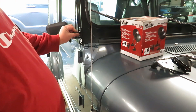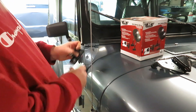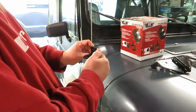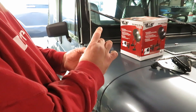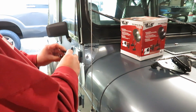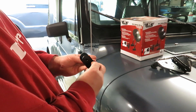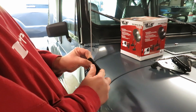I want to get two bolts in. So the only option I have is I'm going to have to score this an eighth inch off and cut it down here so I can get that lip through there. These hole patterns, I'm going to have to elongate them, bring them down closer. That may not even work because it's just too tight, but I think I might be able to get away with it. I shouldn't say it fits the CJ if it doesn't fit the CJ at all.